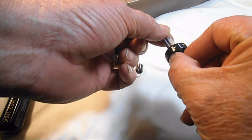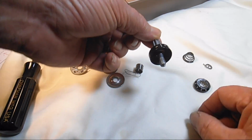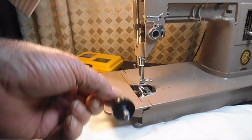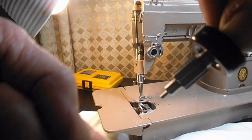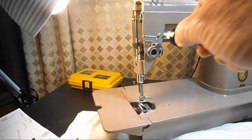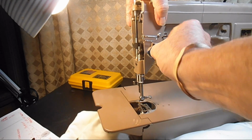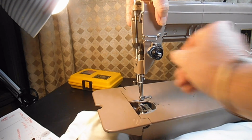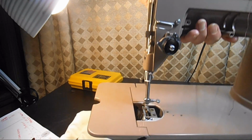And if you want to put that on there temporarily while you put it in the machine, that's a good way to see how level it is, you know. So let's get up here with the machine, and we'll just make sure your pin is in. Don't forget that pin. And we'll just put it right into the hole for it and make sure that the tension stud is pushed all the way back.